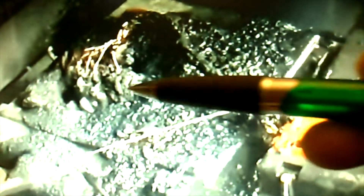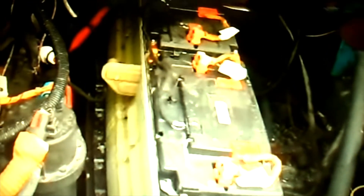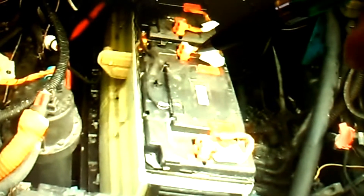But something had to cause a short in here. Stopping at 9:25, you can see all the other BMS cell taps look to be pretty much stock. Can't really tell if their proximity clips are in use — that could be one right there. But overall it looks pretty much stock as far as the satellite board and the BMS pigtails.